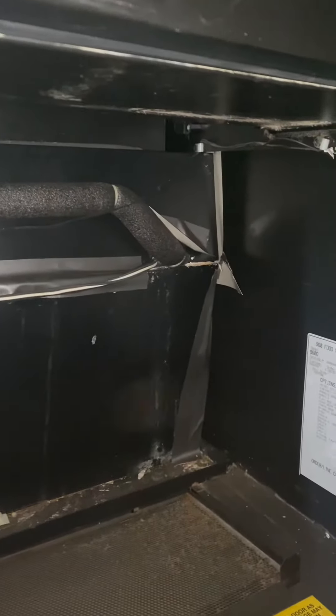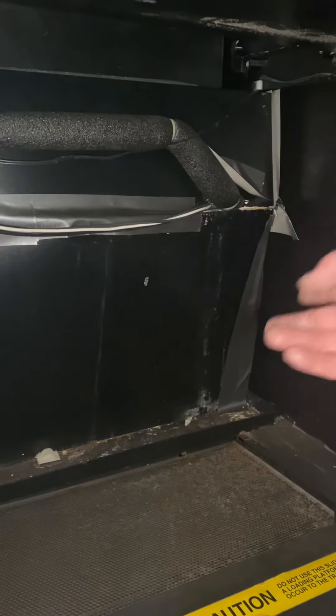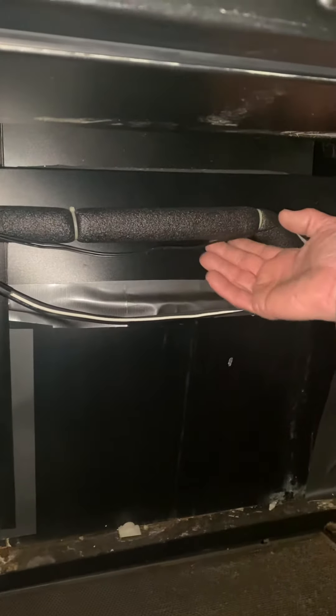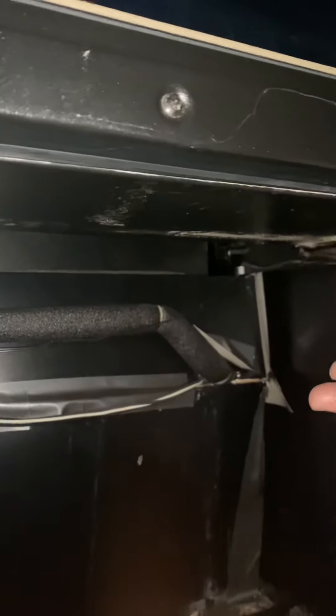I don't know where the air is coming in from — I duct taped it here. The way it works is this whole thing will come off, and there's a big fan that sits right on top, right here. When you take it apart you can see it clearly — it blows up all the frozen air in here. But when that evaporator freezes up it's just a block of ice, so it can't work. You just open it up like this.